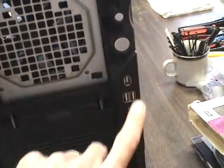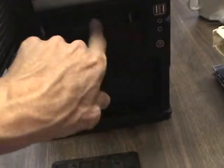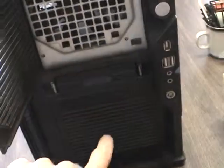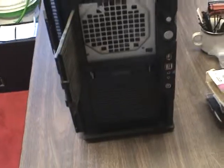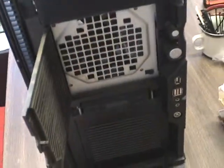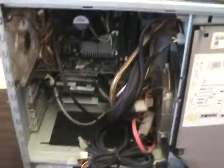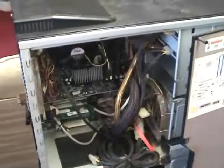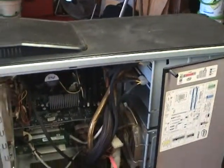Get all your outputs on the front side as well. I wouldn't go ahead and blow out the inside of the floppy drive itself, but other than that, do this cleaning every three to six months and you should have a clean, cool-running system.